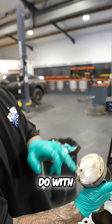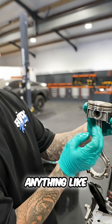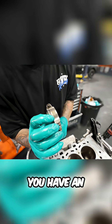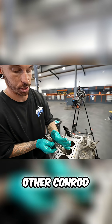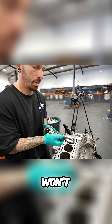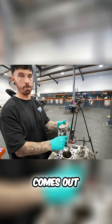That's got to mean something, something to do with these cutouts or the gudgeon pin could be offset, anything like that. And then on top of that, at the bottom you have an arrow which is pointing to the front here, but that's only because there are little cutouts where the other conrod on the other side will go against it, whereas on that side for some reason it won't. We'll figure that out as we go along, but we know that's the way it came out so that's the way it's going back.